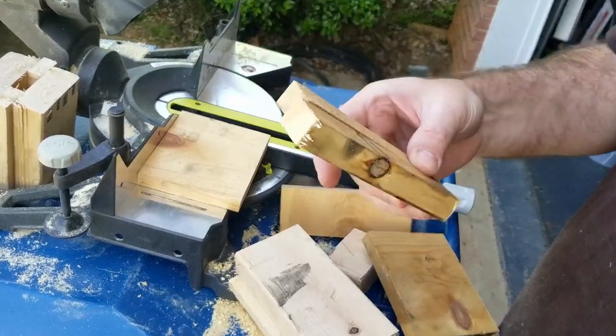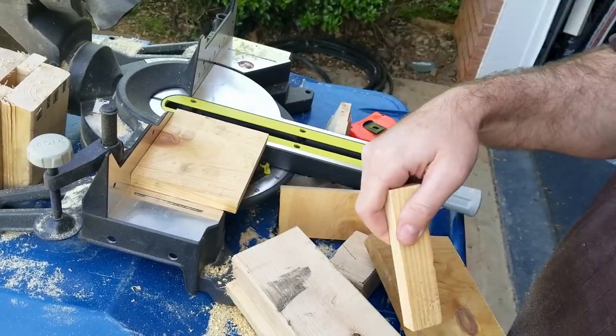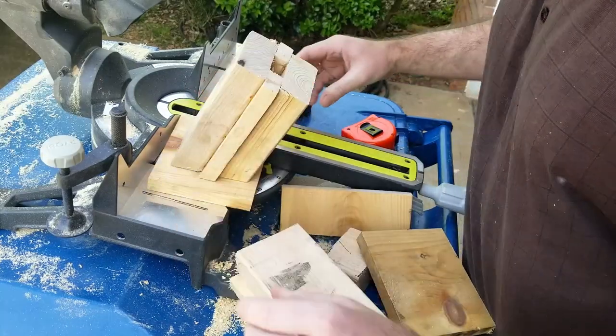I like to keep these little giblets. They make it a lot easier for changing tires. I use them to hold the rubber down on the bottom bead and on the top bead while seating that final piece of the top bead. Makes life easier.